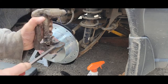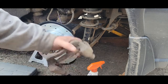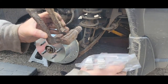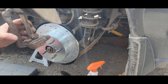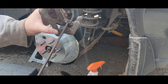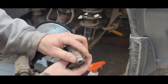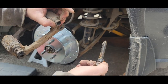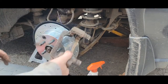I like to look things over — I don't see anything wrong other than corrosion. We'll rip them out of there and put the new ones in. But first I need to make sure they fit in well. Let me show you the corrosion — if you can see that, if I try to put the new stainless sliders in they won't go all the way to the bottom. What I do is take a file and go like this — clean it real well. Some people use a brush wheel but a file works great because it's flat. Then I want to take these pins — I've got to work that rubber back so we don't hurt it. There's a pretty good amount of grease on these pins, a little thick, so I'll clean that out and put in fresh grease.